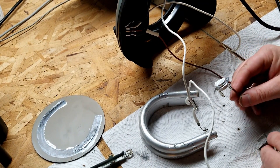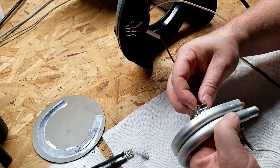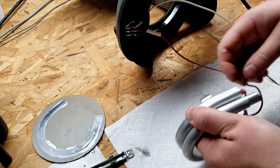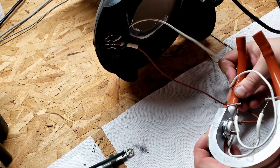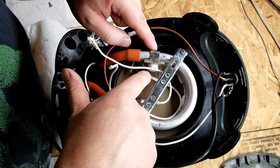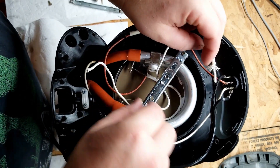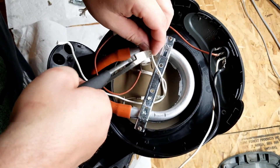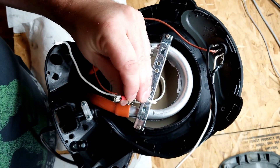Now comes the tricky part - trying to match this up. We're gonna need this little sensor in there, and really you don't need the sensor in there, it's just a safety thing. So we got one lead coming to the temperature switch, then that'll have to go into the heating element, come out of the heating element. We really don't want those wires in there, so Mongo's gonna make a little jaunt from there to there - cut it there, strip a little bit off, and we can get a little connector crimped on.